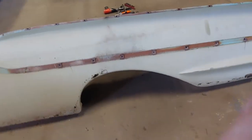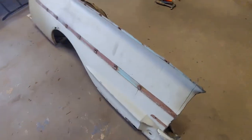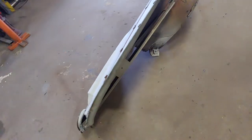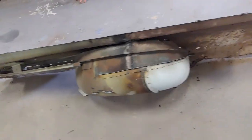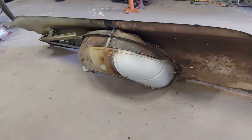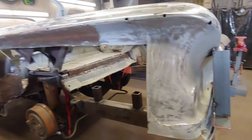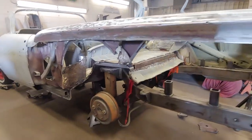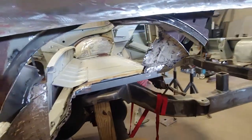I made some progress on the quarter panel of the '58 Chevy. I cut away the inner structure I'm not going to need and the material from around the inner fender well, trying to save the lower rocker as much as I can use. I need to get it up on here and fit the '58 as close as I can to stock.